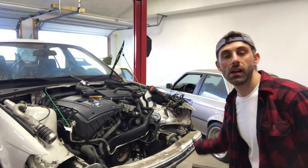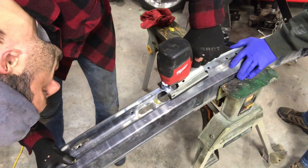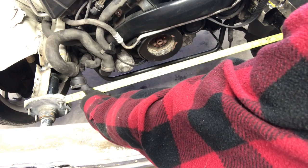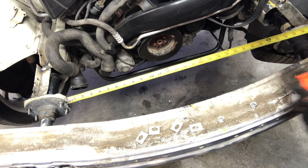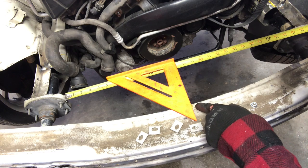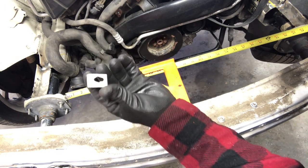What I've done with this bumper bracket here is I've drilled slots in the front so that the bumper shock mounts can move left and right, because I needed to widen both of the shocks in order to fit the radiator. Now that I've widened it, both of those bumper shocks mounted to the main bumper bracket are off — so I slotted them, they're extended, and now I have to make sure that the bumper bracket itself sits evenly. It's 26 inches wide is the frame rail distance I'm going for, so half of that is 13. If I put a square up here and measure it, if I'm plus or minus a quarter inch, I'm fine. It matches up with my mark — it's pretty straight. The bumper is set where it's going to be, and I'm going to start to weld up these nuts right along the edge.